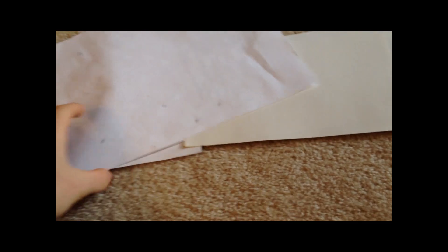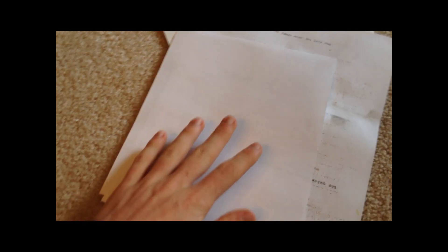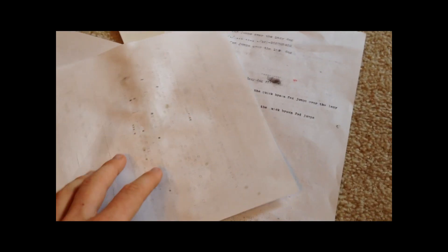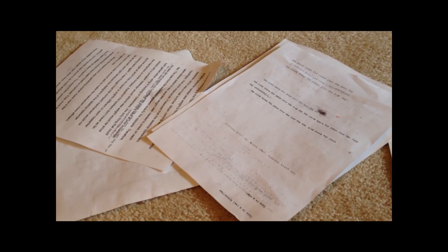You also want to use two sheets of paper when typing. Two sheets provide the best protection for the platen — if you only type with one sheet, you'll probably do some damage over time. The sheet you print on should be on the bottom when you insert it, and the one behind it should be any old piece of paper. This keeps the platen in better condition because keys like the period tend to slam through paper and cause indents in the platen. It's simple to do, so why not do it?